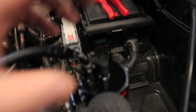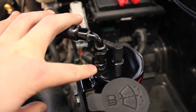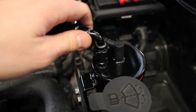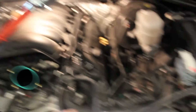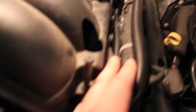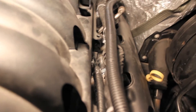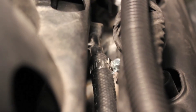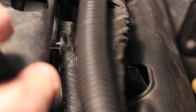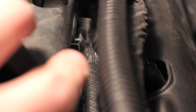This is the offset fitting with screws on — I've got it nice and tight with a wrench. Don't over-tighten it or you'll break it off. This goes to your driver's side about halfway back, and the other side goes to underneath the throttle body. I ended up pulling this wire harness out to get more room. You see where that silver clamp is? That's where that hose is mounted — it slid on pretty easily, that's why I put a clamp on it; I didn't want it falling off. Be careful: I knew a guy who broke the plastic bib off the intake, and if you break that off you have to replace the entire intake.